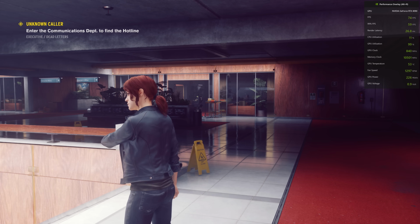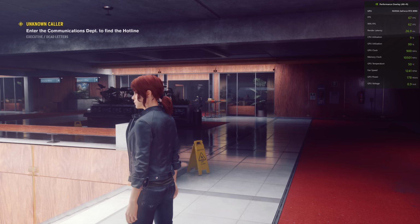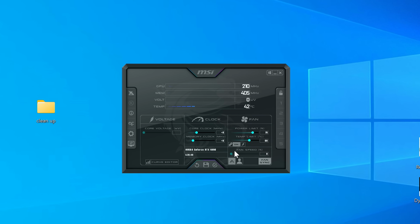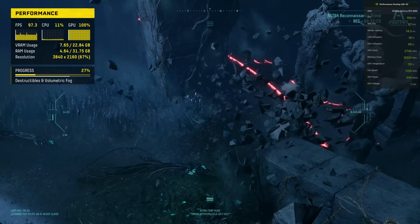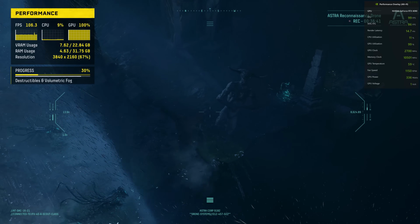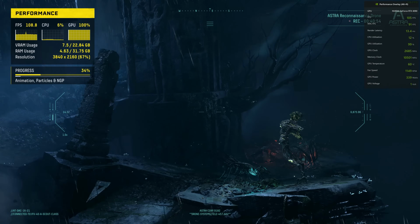There are other methods for playing with power limit, including MSI's Afterburner, which you may prefer if you don't want to create an Nvidia account or choose to not install their software. Although GFE is installed with a default driver installation, you can tell the software to not install this specific thing during a custom installation. Honestly, a combination of undervolting and power limits can achieve great results, particularly on AMD, but we're going to be focusing on keeping things as simple as possible here.